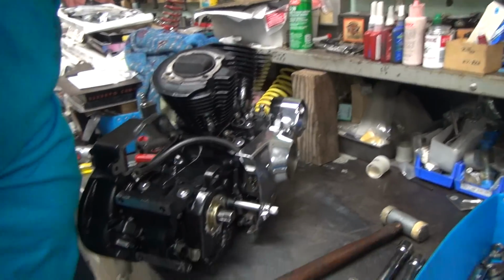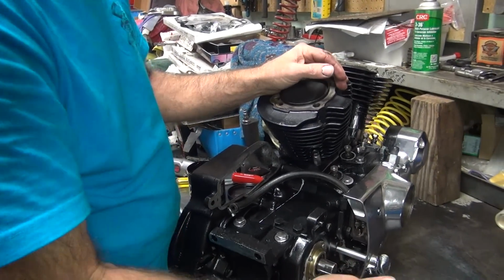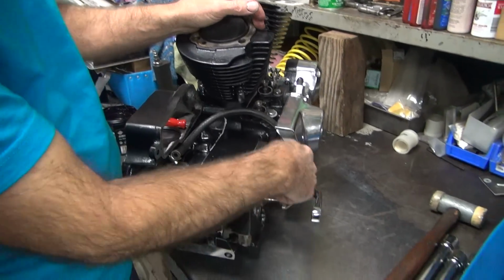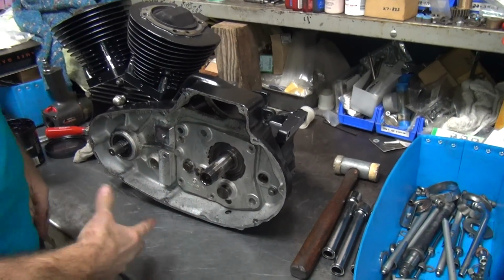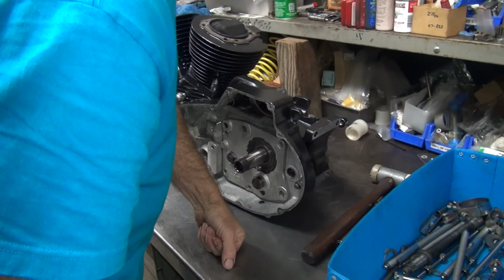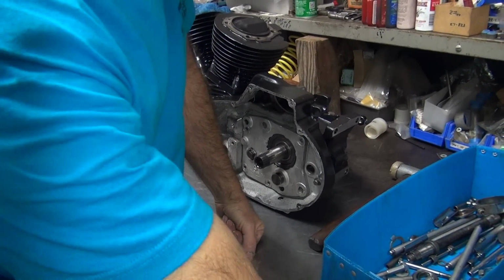I'm going to do that shift lever here. Okay, we're engaged. See how it returns back? So that means I've got the bushings working good. Okay, it takes four bolts to hold this on. I had them sitting where I could get to them quickly. Of course, that was a while ago. Looks like they need to go over to here now.